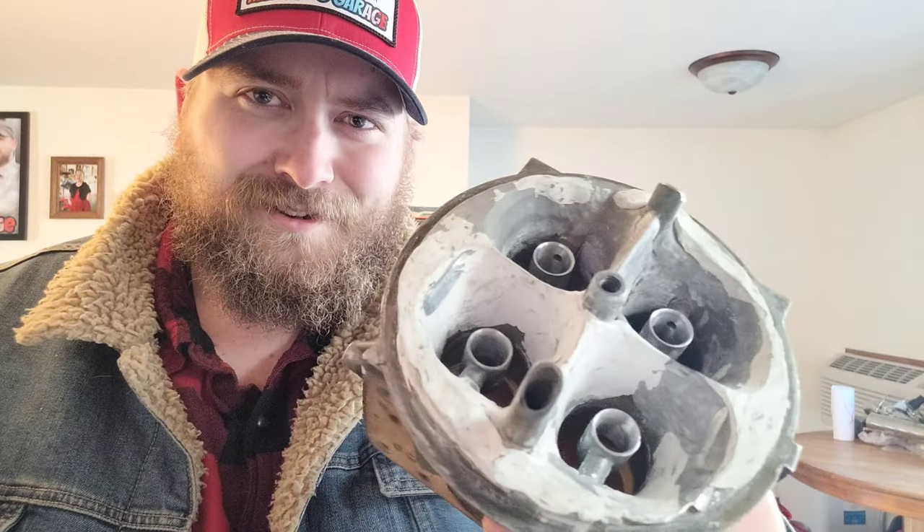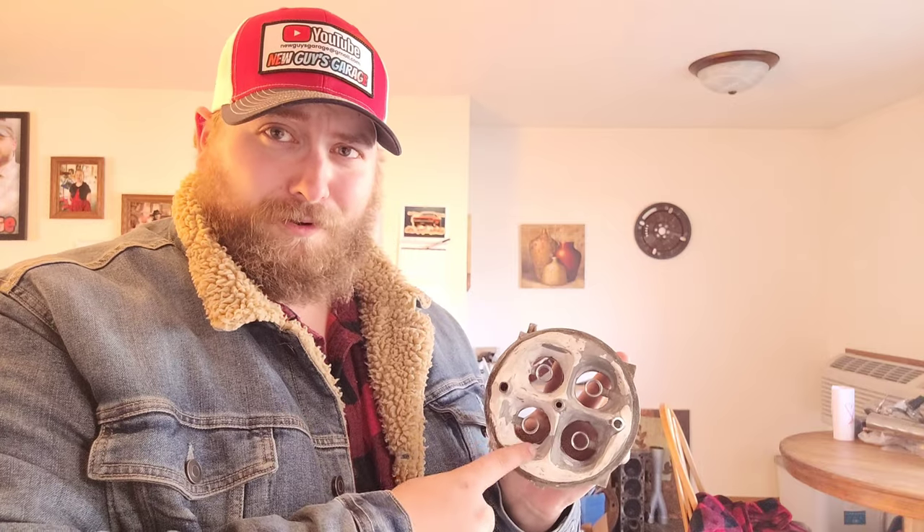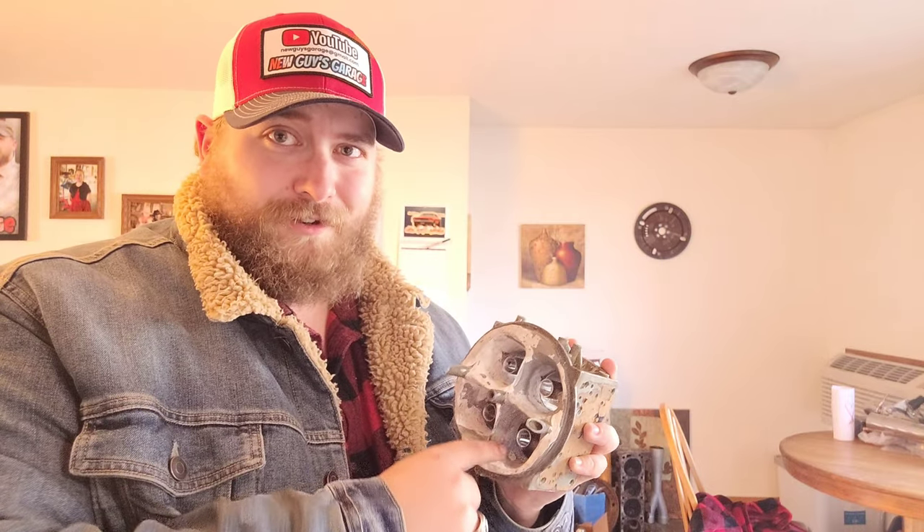Stock it is no longer. This is our XMC channel collaboration project that we're doing with Joseph Nowak. I've been doing some stuff — if you haven't watched the other videos, let me catch you up real quick. I filled this thing with JB Weld in hopes of achieving more CFM, or at least more booster signal as a trade-off from stock. We've already gained about 84 CFM over the stock configuration with the modifications we did previously, before all the JB Weld.